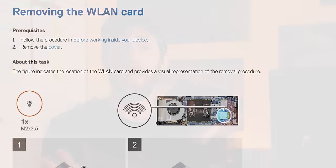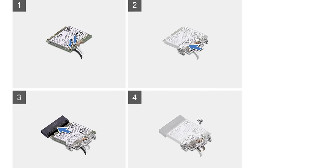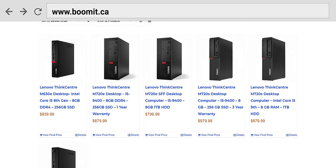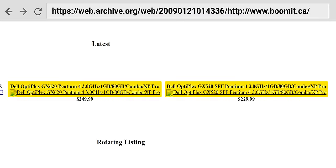It does have Ethernet, so it's up to you. Whatever you want to do, Dell has an excellent service manual with guides on how to access and replace everything, complete with part numbers. This is just something you don't see on consumer-grade machines these days — clearly we have the technology. This is one of the reasons Anthony's old computer shop really liked selling off-lease Optiplexes and Vostros: so much easier to work with, to a limit. As for the CPU, it's not replaceable, and because we sat on our butts for so long, we're looking at an 8th-gen Intel Core i7-8665U — a quad-core Coffee Lake mobile CPU with a max turbo of 4.8 GHz.